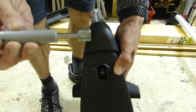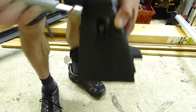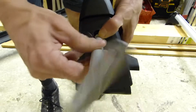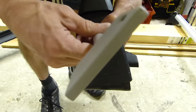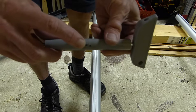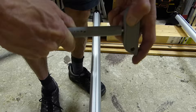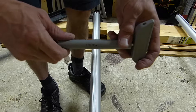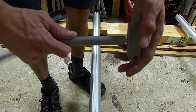You have to line it up properly — there's a little arrow on the end and a little arrow on the bolt inside, and you line the two things up and then tighten it. Eventually it will start clamping against the side of the car. When it reaches the right level of tightness, the bolt has little arrow markings which gradually line up to show you've got six Newton meters of tension, which is the right amount for the car. At that point you stop turning the handle.